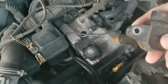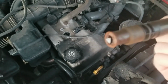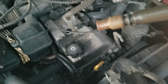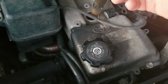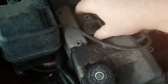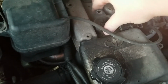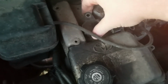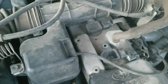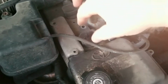Now that we've got the plug installed, we are going to put the coil pack back in. I've put a little bit of what's called boot keeper on this, and what it does is help keep this from seizing onto the plug. If you've ever had trouble trying to pull one of these off, there are several different brands out there, but what it does basically is help keep the plug wires, or in this case the coil, from sticking onto the plug. I'm sure that some of you guys may have had that happen to you, and I'll put a link down in the description to where you can get some of those also.